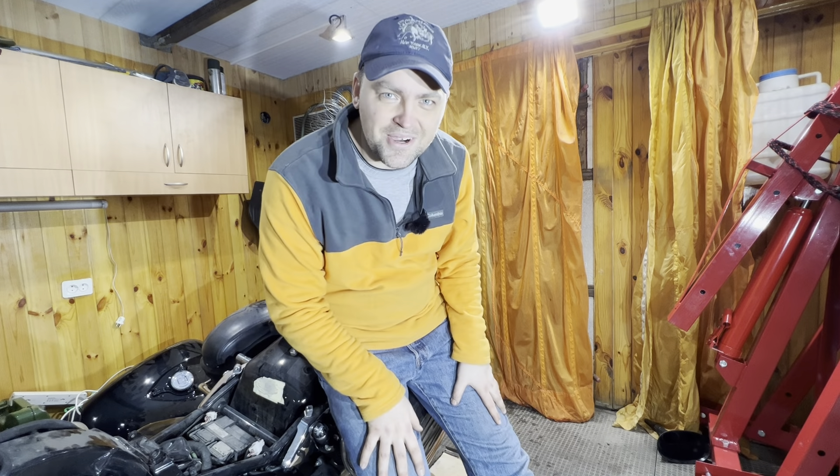Here we have the leak from this linkage point. There's a rubber bushing that absorbs shocks — it's still in good shape, the rubber looks fine. I still wonder why there's a leak here; probably the metal there is very thin. This is the second time I've had the same problem with VTX radiators. If anyone knows of aftermarket or tuning radiators for the VTX, please let me know — this problem is driving me mad. I'll pass this radiator to someone to weld, but I might need to buy a new one, which is very expensive.